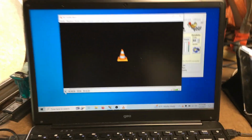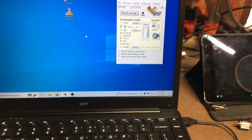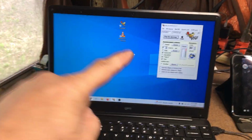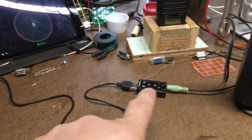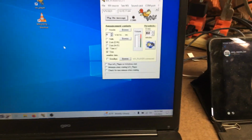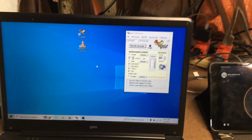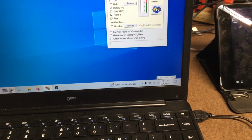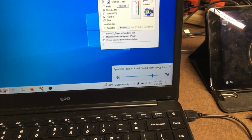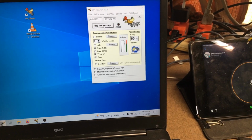See, two different sounds. So, as long as you select that in the software, for an example, I can either listen to a YouTube video over my speaker, or I could plug in a headphone jack, and it does not interfere with my date and time because that's being pointed to a separate sound card. So as long as you've got a USB sound card and the software you want to use has the capability to select the sound card, you can do this. Okay, now let me show you. Now if I select this down here, which would be my main speakers for the computer, if I go to USB 2, well, guess what's going to happen? And I hit play, it's going to play over my speakers.